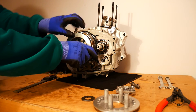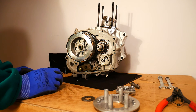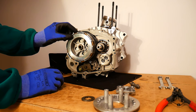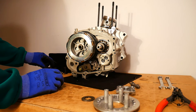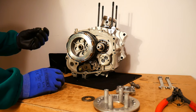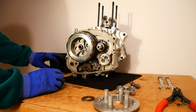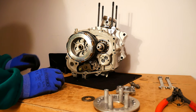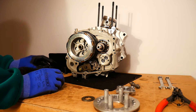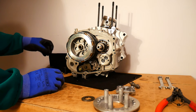There are many things that can affect the performance of a clutch — it's not just about the friction plates. It's also about the springs, and about how much you've torqued the bolts down. You have to torque down the springs to a particular value specified in the service manual when rebuilding your clutch to ensure the right pressure is applied.